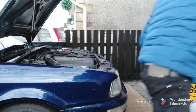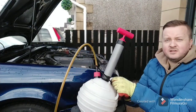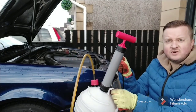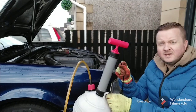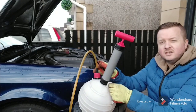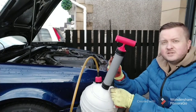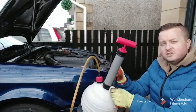For this oil change I'm going to be using an oil extractor. These can be had on Amazon or eBay for around £40 for a Laser or Silverline one. You'll pay double for one with a Pela sticker on it but it's exactly the same item. It works on vacuum pressure — you've got the long thin lance which goes right down the dipstick tube into the bottom of the sump and you simply pump the handle. There's also a spout so you can easily pour your used oil into a waste container without any mess. The first thing to do is give it a wipe since it's been sitting on the shelf — it goes right inside your engine so it's got to be super clean.